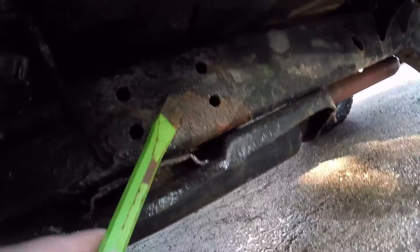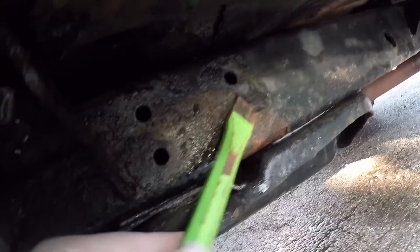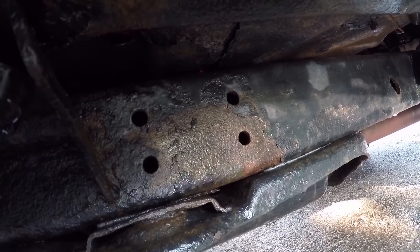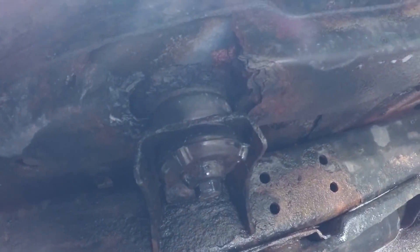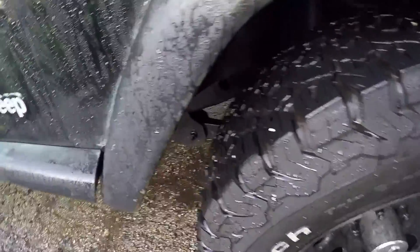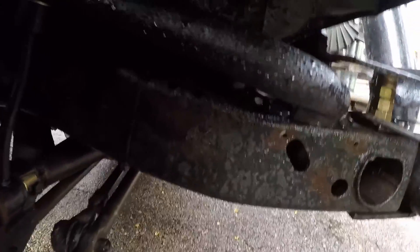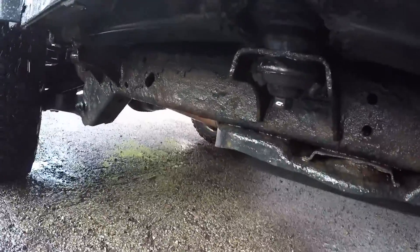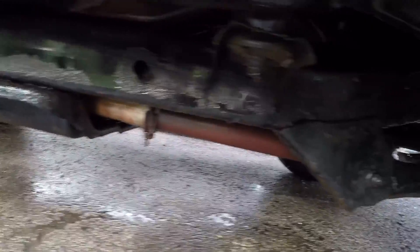You can see how the water is trapped under there, and that salt water during the winter gets trapped under there and kills your jeep — basically any vehicle, which is probably why this rusted out. I got the jeep sprayed down as much as I can and I'm going to let it dry overnight. I did get a bunch of chunks of old underbed coating off — as you can see on the ground there are chips all over. If I didn't get that off it would trap in the salt water and make the jeep rust even more.